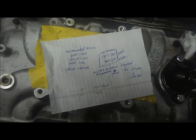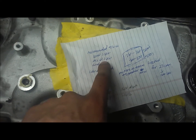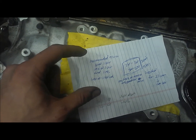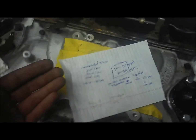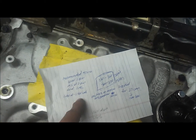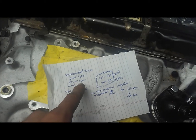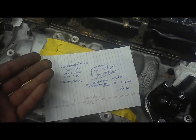They have a recommended valve spring. It's important to recognize the seat and open distance measurements — these numbers are calculated from that height. When your valve springs are just sitting there they'll be much taller, but when compressed with the retainer on, they'll be compressed more and need to be at these heights. In some cases on these particular heads I'm using, I have shims to get the valve springs right. For open height, you consider your camshaft lift — starting at 1.8 with a 500 lift camshaft, you're going to be at 1.3, or just a little less at 1.25. You want to go a little past that to make sure you can never get into a coil bind situation.